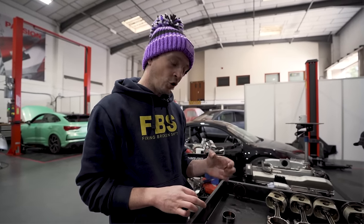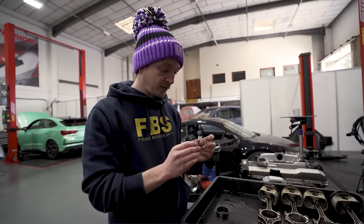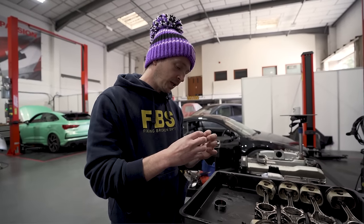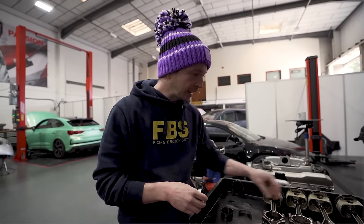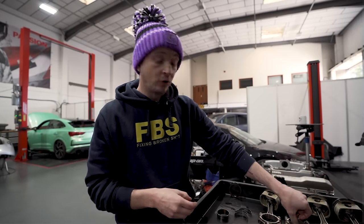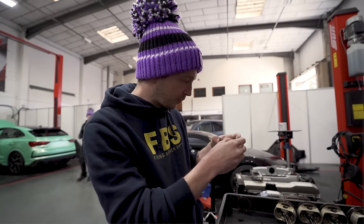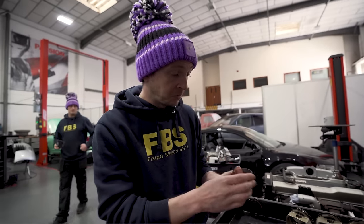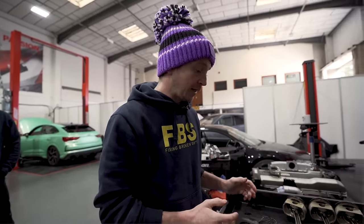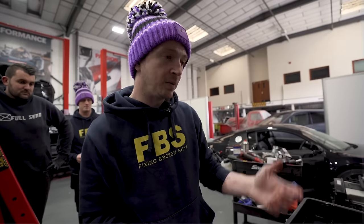I've consulted my book and it literally says oil degradation. I don't think it's overheating, it's not over-speeding — when you over-speed an engine with low oil lubricity you get wipes. Whereas this looks like corrosion on a bearing, which is why we thought: is it moisture? But I don't know. It's done it consistently on all of them. Anyone who's got any ideas or has seen it before, let me know. How did this present? At 2,000–3,000 RPM, a knocking noise — basically rod knock.